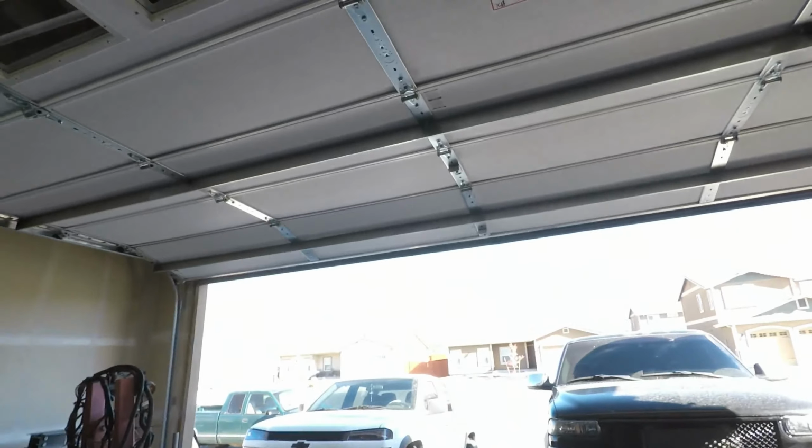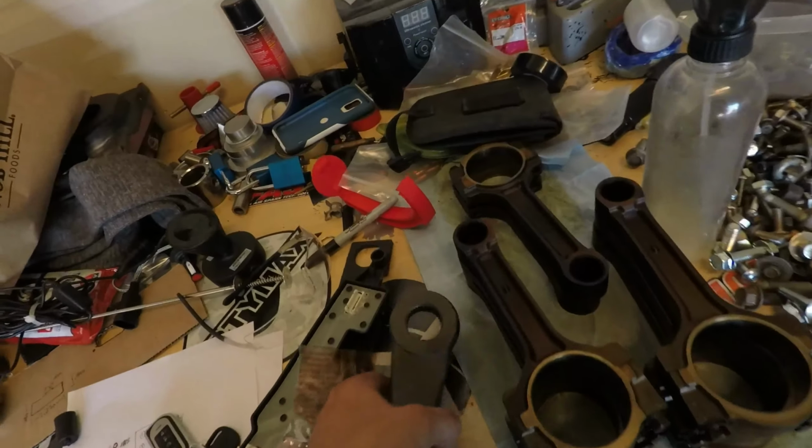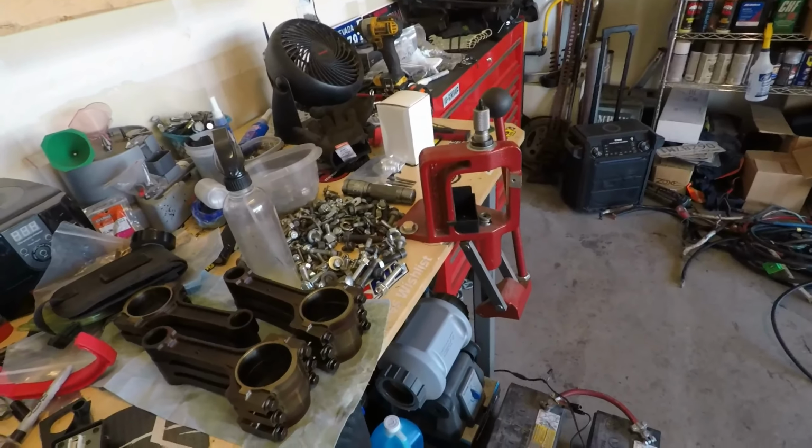And I finally got around to redoing the front end. The only part I have left to do is the pitman arm, which, if you've seen any videos of that truck, you know the steering wheel is off. Because you look here, they have keyways. There's 4 keyways, so you could be off 90 degrees or whatever, which is the case with that truck. Whoever did it didn't line the steering wheel up. The only thing that sucks about that truck is you have to pull the steering box out, but my pressure line on the power steering pump is leaking anyway, so I'm going to replace that.